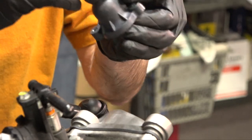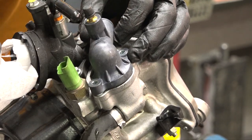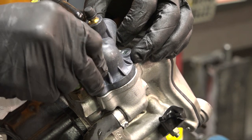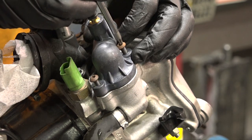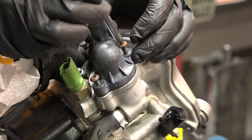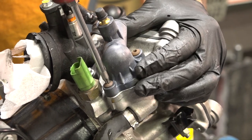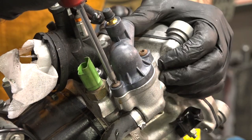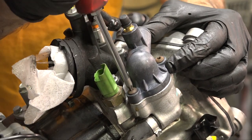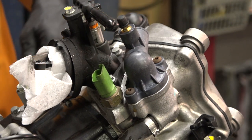It comes with a new rubber cap — put that on. Carefully set this in place and go ahead and replace the two screws. These are just clamping down, and the nice thing is the plastic housing has steel inserts so you don't have the risk of cracking the outlet by over-tightening these screws. The reason you'd replace this cover is that the fiberglass reinforced nylon part just fatigues and warps from heat cycles. It is possible to resurface it, but they also tend to start leaking from the bleed screw. Why take any risk with coolant leaks — that could be detrimental to the motor? Go back and forth and you've got it all replaced.